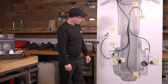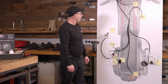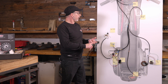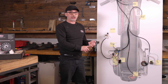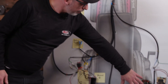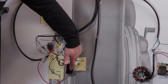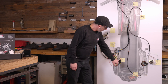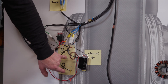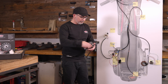So now we have the whole system connected and we can run the scooter on DC. We have the advantage of being able to connect LED headlights, LED turn signals, and various bells and whistles to the DC power — more on that later. We have now converted the AC voltage, which is always produced by the ignition, into DC voltage via the rectifier. The same goes out via the red cable and is fused in a battery, which is of course only written down here as an example.